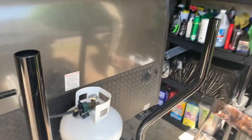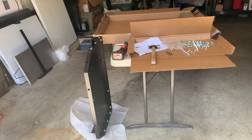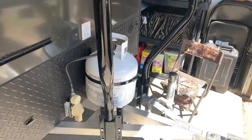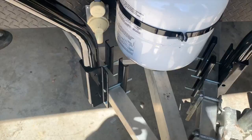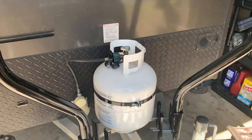If the tray winds up too far out front, I'll have to change the position on the tray to get these balanced. This will probably involve some trial and error. If you have an In-Tech Flyer Pursue like mine, I'll note exactly where I put it — assuming you placed your bracket just ahead of the A-frame support member. Other people will have a tongue box here, but my 2018 model did not come with one.